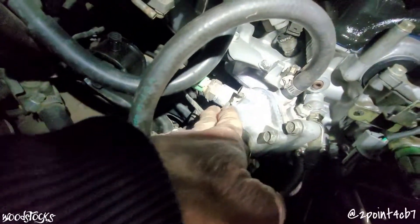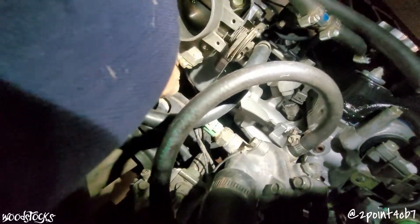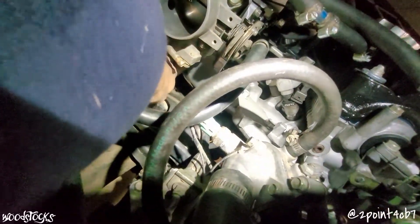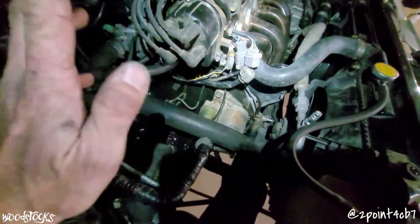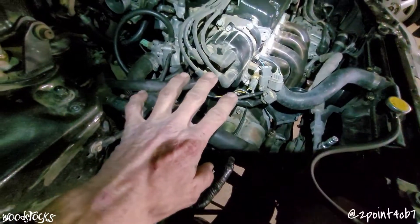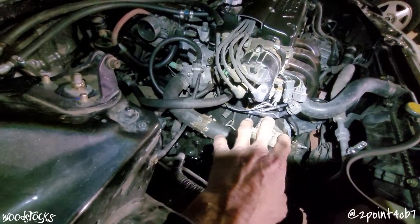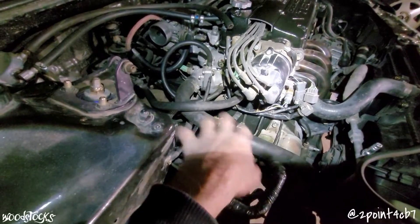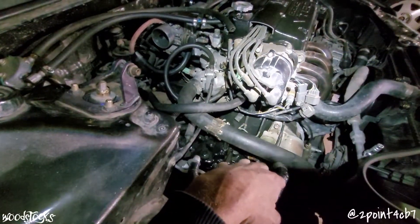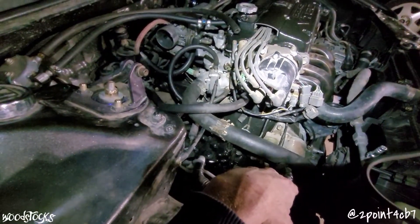My ground for my cooling fan back here — that one's okay. Back here I've got another ground for my ECU plugs — that one is still hooked up and looks fine. So like I said, everything looks okay visually, and I'm getting the same exact codes no matter what parts I've swapped over. I can only assume the problem has occurred somewhere inside the harness, so I'm going to pull this harness out of the engine and have to open it up and figure it all out.